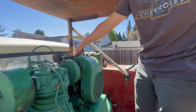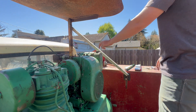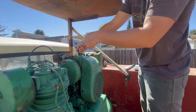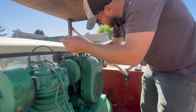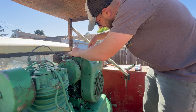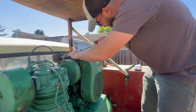The first few things I'm going to do is change out this old spark plug, check the oil, and drain the gas and put fresh stuff in. I don't know when the last time this was run, but the truck sat unused since about 2012, so I assumed this wasn't used any more recently than that.